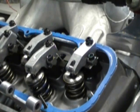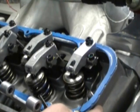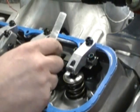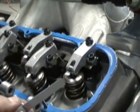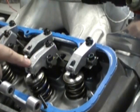If you're adjusting valves when the engine is cold, aluminum-headed engines I typically adjust about two to three thousandths tighter, because aluminum heads swell with heat. For cast iron headed engines, I'll typically adjust them the same cold as I do hot — they don't seem to have the same amount of growth.